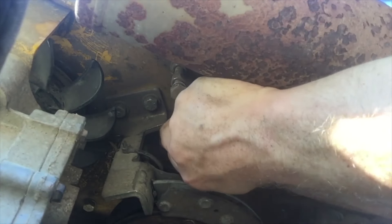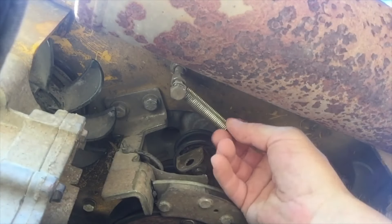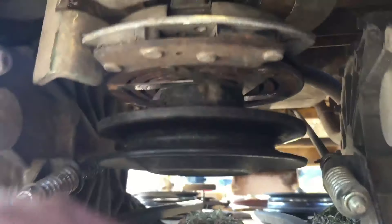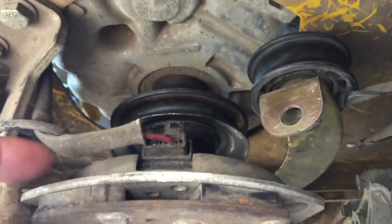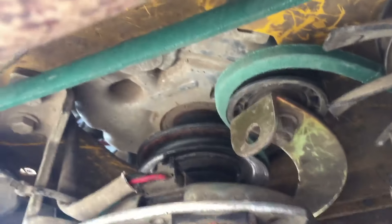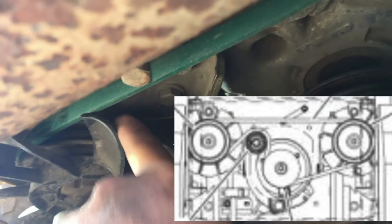I just need to kind of get my hand in there and unhook that off, and that'll allow me to get the belt up in there. This is the pulley that runs your belt that goes to your deck mower, and then up in here you can see the pulley that is your drive hydro. Right here is what we just took the spring off from for our second step. Okay, I got the new belt on — I slid the belt in up over the top of this side.